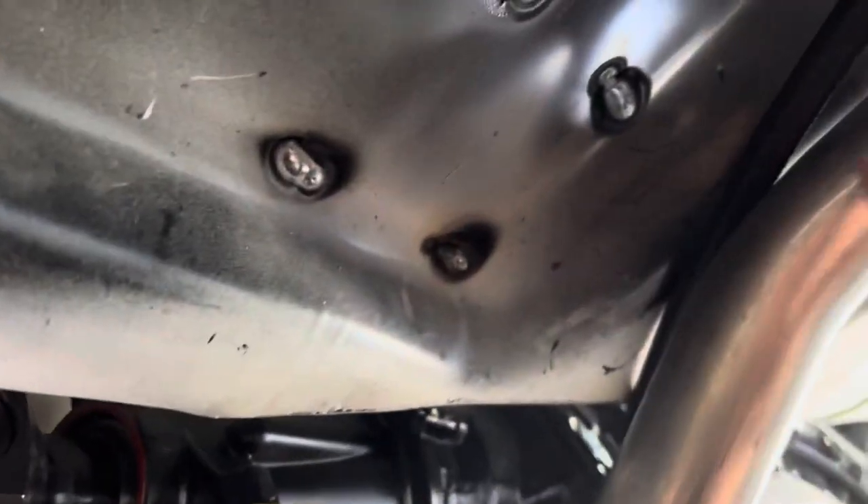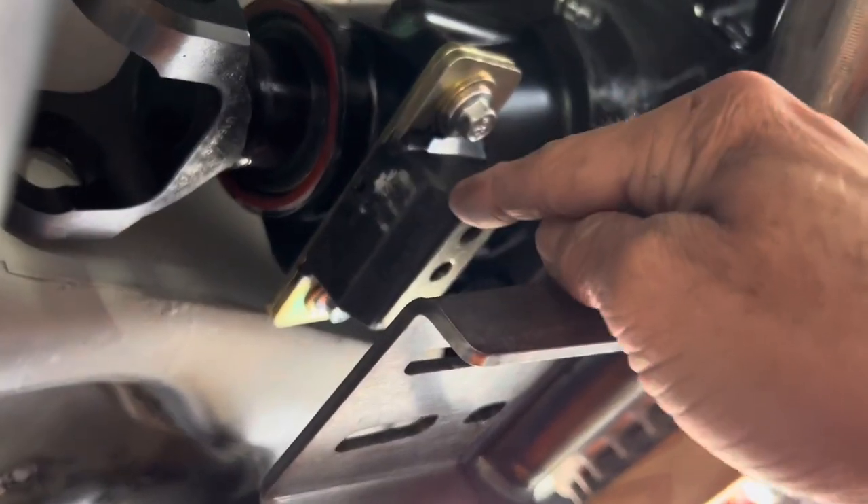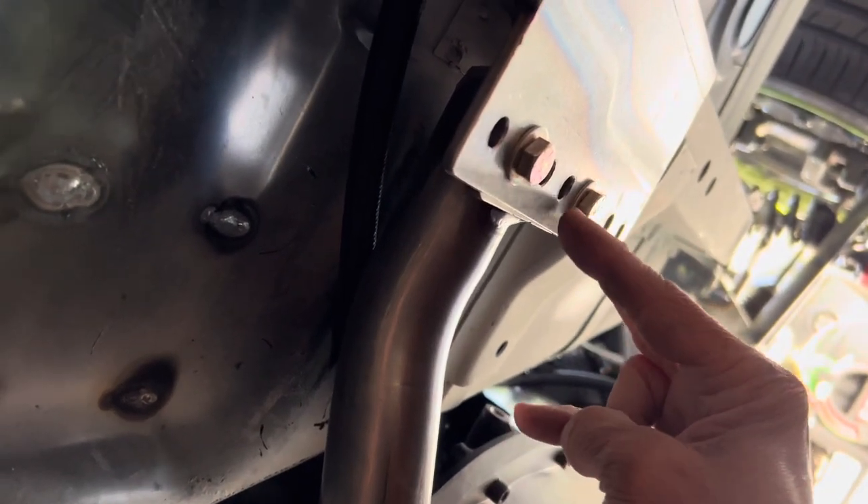I've got to be very careful because the yoke is almost in contact with the transmission tunnel, so it's going to have to slide a little bit to achieve the right configuration with this crossmember. What I'm going to do is cut it here and here and also here and there — separating the center section from the outer section, then get it to mount up flush with the mount. I'll rotate the bar, possibly move the position forward a bit, to make the whole bar rotate to match its new angles, and re-weld it in position.